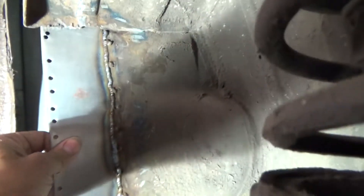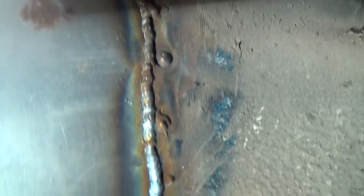The front repair section has now been fitted in place and welded. I've seam welded it down the joint. Let's have a little close-up of the welds. I'm quite happy with that — I've got quite a nice small weld running down through there.